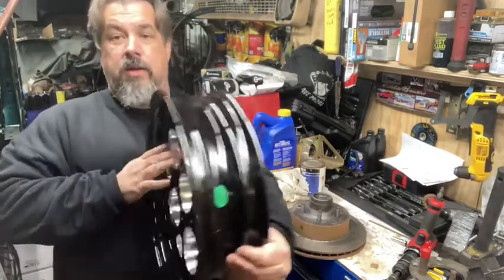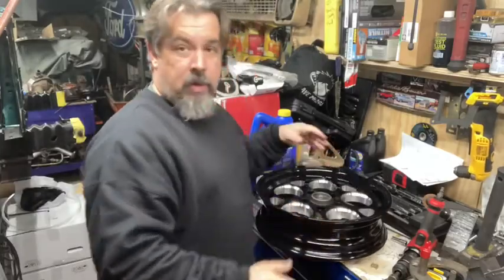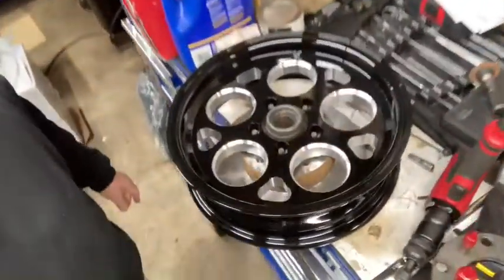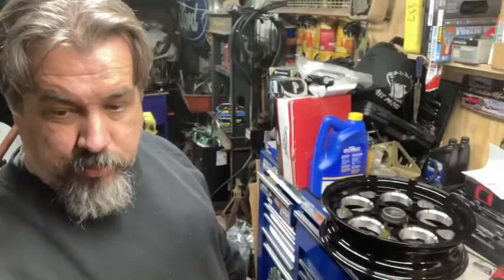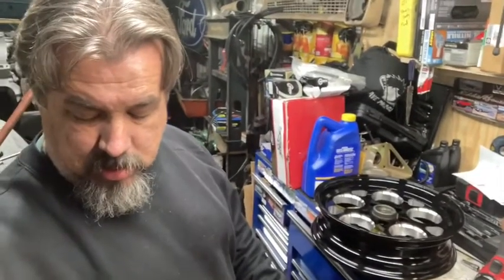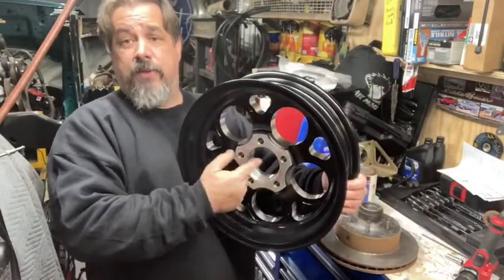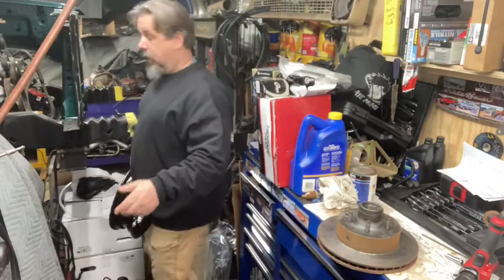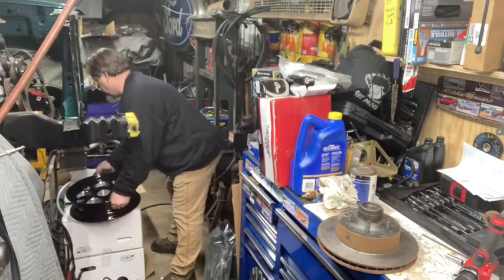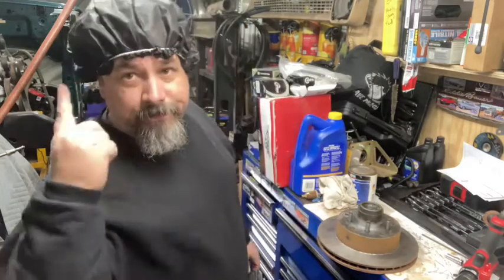These are the wheels that I'm running — 15 by 4. I'm going for like a drag truck look. As you can see, everything fits great. Since they're acorn style wheel lug nuts, I don't have to worry about anything else. I was actually able to go on the website where I bought these wheels and I got all the dimensions. I took those measurements and cut the exact material off of the rotor, so now I'm able to use the wheels that I want. And I love getting new wheels because you get a shower cap with your new wheels every time. It's tight, ain't it?